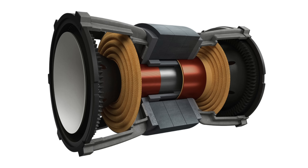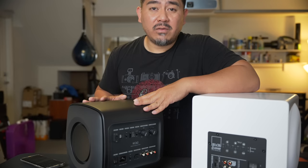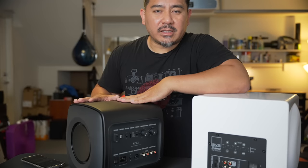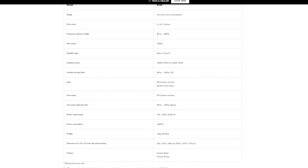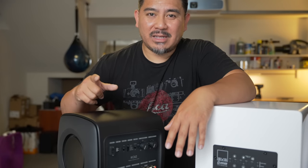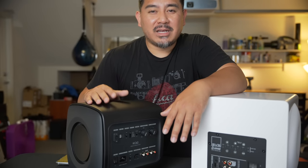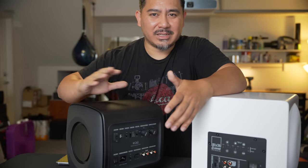With the force canceling drivers — actually two drivers connected in the middle where the magnet is — the cabinet just doesn't move. Same thing with the dual opposing drivers on the SVS. Both also have inverted surrounds, with the KEF's crazy design helping to control excursion at max. The main spec everybody was talking about is that the KEF supposedly hits down to 11 Hz with dual 6.5-inch drivers at 105 dB — but what we found out is that it can't do both simultaneously.